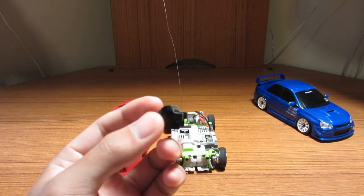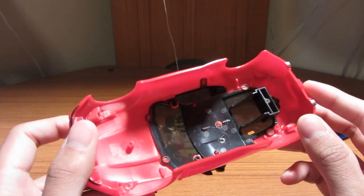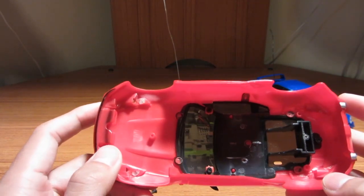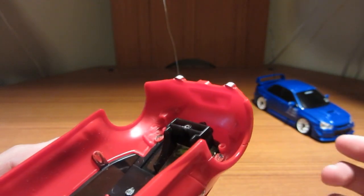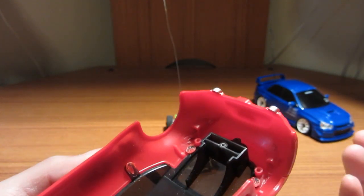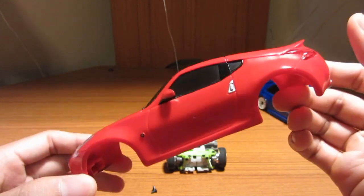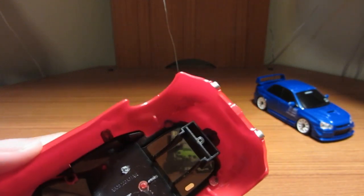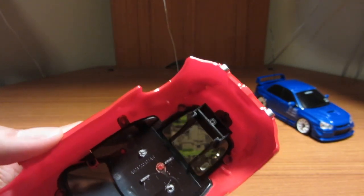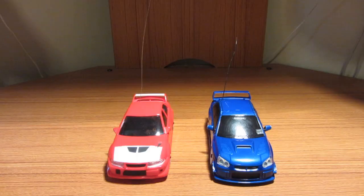The body itself is pretty much untouched. Usually when you lower the front by lowering the front clip, you also sand down the rear where the rear clip sits. In this case, this car doesn't really need the rear end lowered - I could do it just a little bit but I got a little bit lazy. On other cars, if you just lower the front end it'll sit staggered. To compensate, you use the same technique - take sandpaper and sand that area down until it looks good.